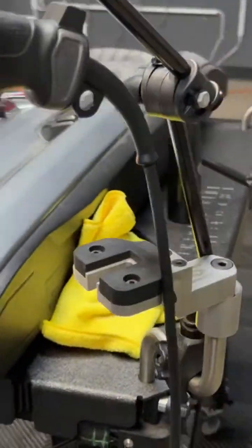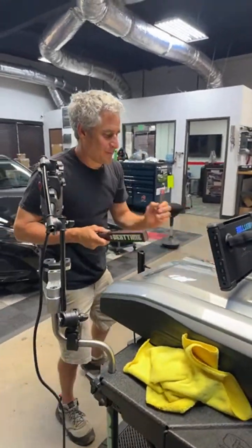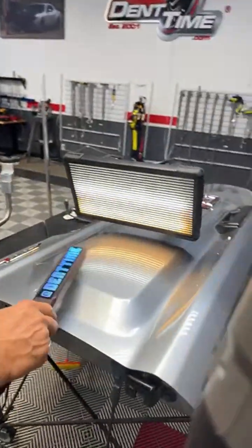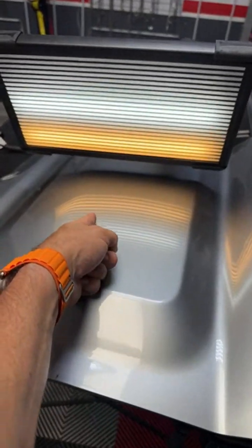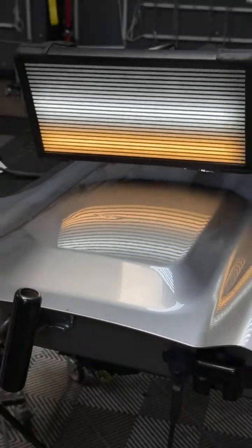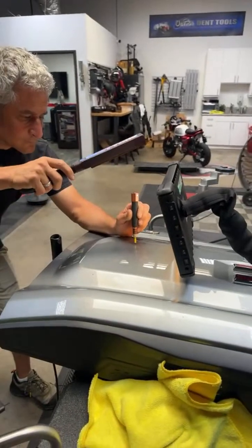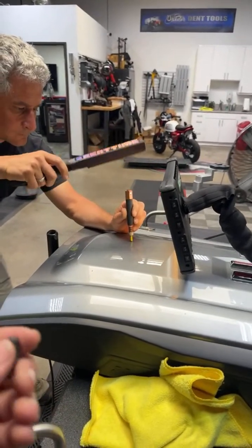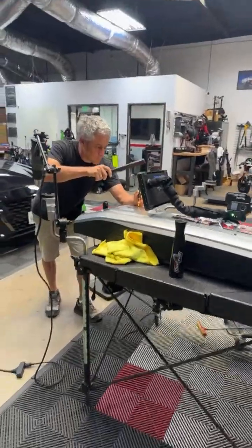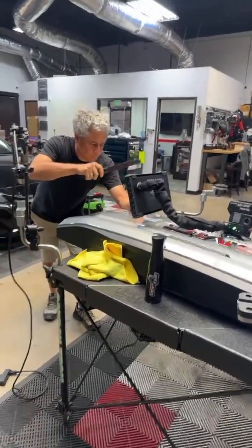How can you get rid of zippers? Start by trying to clean up each section first — you don't show much of a zipper that way. Do all increments. If you had a zipper mark from right here over — the whole thing was zippered — you would do small sections. You'd either put a glue tab, like a crease tab, bring it all up super high, and then tap down. Zipper effects are caused from going too fast. If you have zipper effects, it's because you're going way too fast. You're not concentrating on a small section — you see the whole thing. You want to be disciplined.